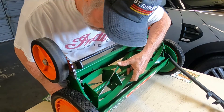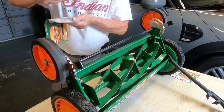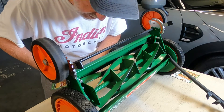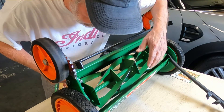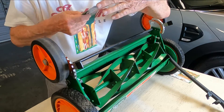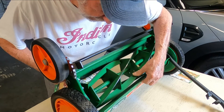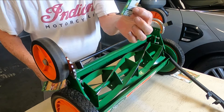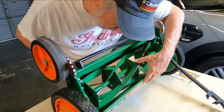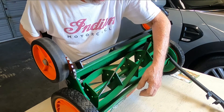What you do is adjust the blade to where you put the paper up in there perpendicular — right in, not like this but like this, right up there like a piece of paper that you're going to cut with scissors. You want to make sure that it cuts all the way across. I've got about four inches there to check. I just give it a quick little spin and it cuts it off nicely. Move down and you should be able to do the same thing again — and a quick cut.